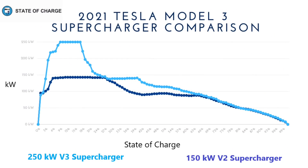I'm really surprised it was that close. Most people think 250 kilowatts is going to charge so much faster than 150 kilowatts, but you have to look at the whole charging curve. Looking at the power chart, the V3 supercharging Model 3 jumped up to 250 kilowatts at about the 9% state of charge point, relatively quickly reaching full 250 kilowatts. However, it only holds that until the 17% state of charge point — so only for 8% of the charging does it take in the maximum charge rate, then it drastically drops down.